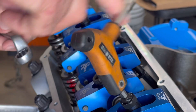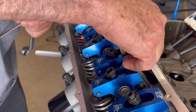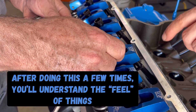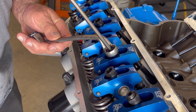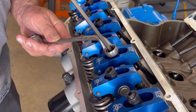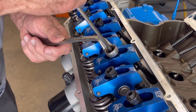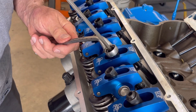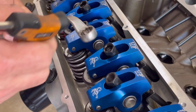That's what Jimmy just explained when he was moving the rocker back and forth and pushing that down. Basically you go through this: you put it on the heel of the cam, you get that feel just snug, then you do your quarter turn and tighten down. If you're watching the inside of the lifter when you tighten this up, you can see if you're running the adjusting nut too far down — especially if the lifter moves, that's too much. On the next one we'll try to get a video of what he's explaining on the lifter.